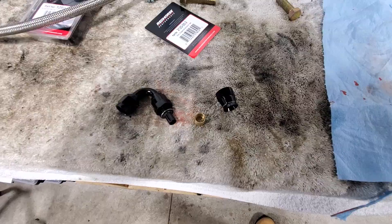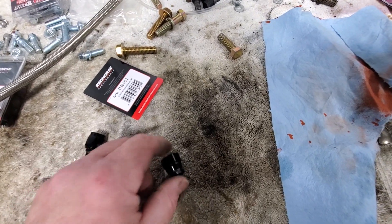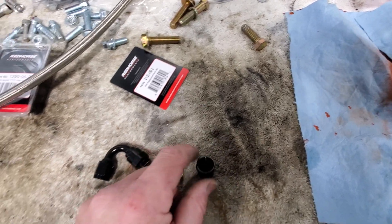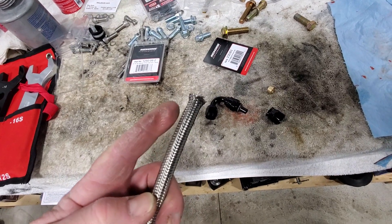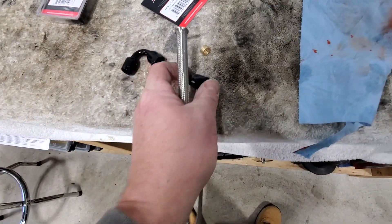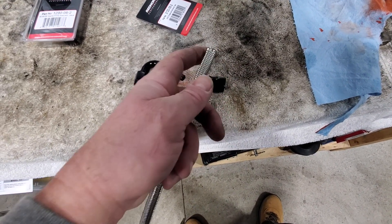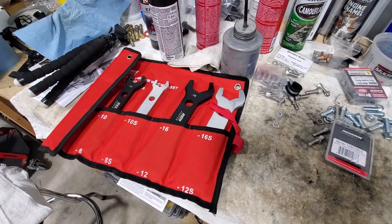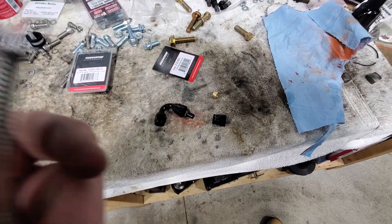Let's get started on the high pressure line. For assembling the PTFE Teflon high-pressure fitting, when you disassemble it you'll see you have a ferrule and a locking cap. When these go on to the hose, you can see the Teflon liner in there with the braided steel — you've got to drop the locking cap piece on first, open this up, get the ferrule in there, and sandwich it all together. We've got a special tool for clamping and holding it in place while you tighten it up, so I'll go ahead and get it in position and then come back and show you how we tighten that up.